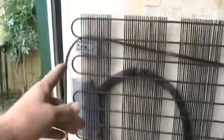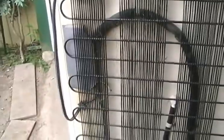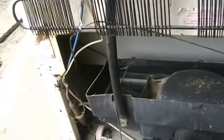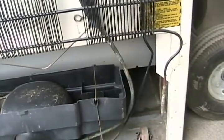Old General Electric fridges have a great big black metal cover right there, and you have to move back this coil by undoing the screws, take off about 20 or 25 screws in that black metal plate, and then the timer's buried in there behind some insulation. That one's the worst pain. Some have them here at the back of the fridge, just around this corner a little bit. There's a little hole where you can turn them to switch them off and on. Could be on either side. Some have a little tin metal box sort of mounted right there on the back of the fridge wall, and they're inside that metal box. Some have them in another little compartment back here just above the compressor. They're such a pain in the butt sometimes to find if you're not experienced with fridges.